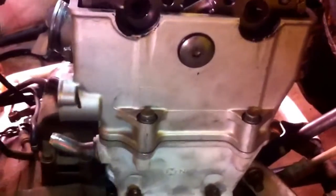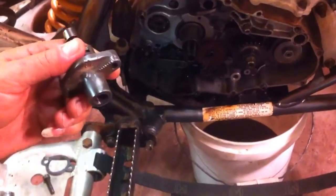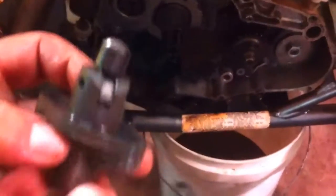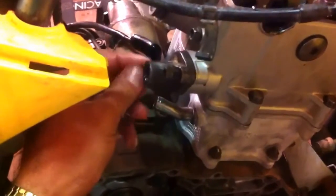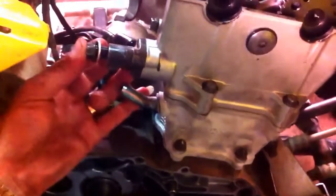We tightened the camshafts and put the side bolt. Now we need to get the tensioner installed for the timing chain. You need to get the back bolt loose all the way so it releases the spring tension, then just press it in. As you can see, it says 'up' right here, so this needs to be the upside. We install a new gasket on it since we don't want any oil leaks. Then you put the two bolts that hold it to the cylinder head, and once you tighten those, you install the spring with the center bolt and that will tighten the timing chain to the needed specification.